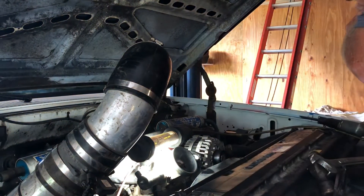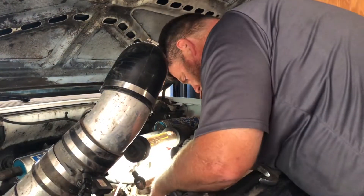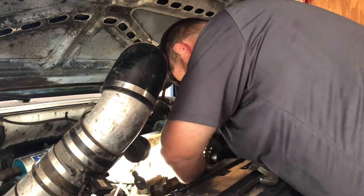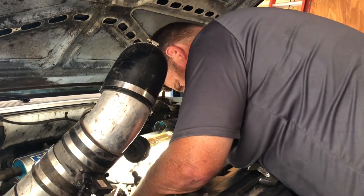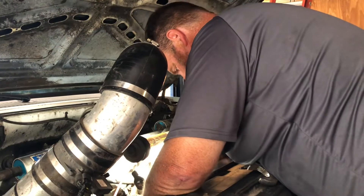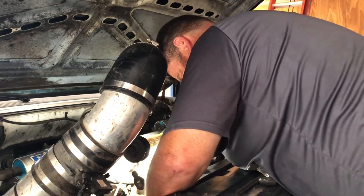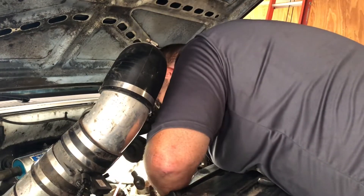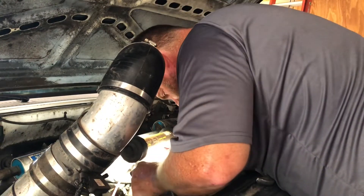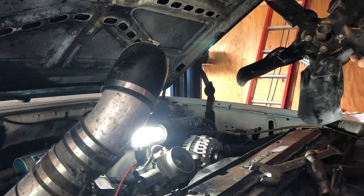Okay, there he goes. This clutch hasn't been on here very long, so we're going to unscrew this and take the fan blades off to wait for the new clutch to come. The biggest thing is you need to know which direction this is — left-hand or right-hand threads. The other day when I changed it I assumed it was left-hand threads but they were right-hand threads, so you're hitting it the wrong direction with the air hammer and you end up tightening the clutch. And there we go — take these four bolts out of the back and wait for the new clutch to come.